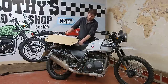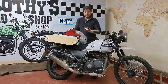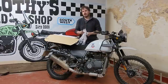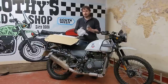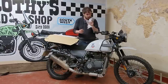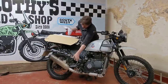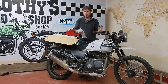I did a video back earlier last year, so I've got the tech cam to fit and install. This is going to give what they claim is five brake horsepower. I rode a Himalayan with the tech cam fitted in Scotland and where I noticed the power gain was more at the top end - you actually got some roll of power from 4,000 RPM up to 6,000. It allowed you to overtake traffic, whereas otherwise I don't think you could. If you're just pottering around lanes you don't feel it, but if you crank it open and ride more aggressively, that's where you feel the benefit. I'm not going to follow up with an aftermarket exhaust - I don't feel the benefit and I like the standard exhaust note.